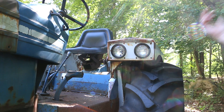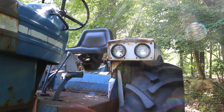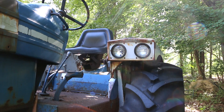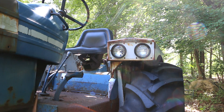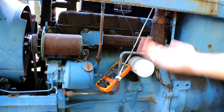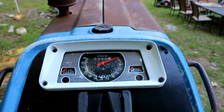I'm a little surprised the headlights didn't go dimmer when I shut the tractor off, but maybe the battery just has plenty of charge. I think this is repaired because the charging system problem indicator light is going out on the dash when the tractor starts. So we've got the generator problem straightened out, at least for the time being.